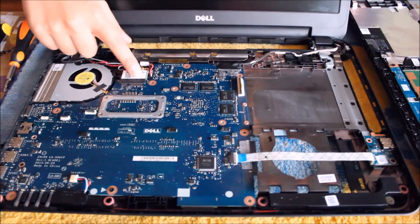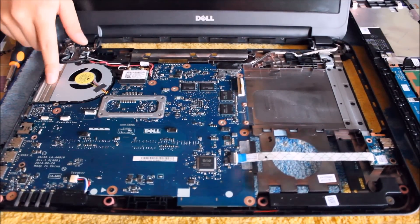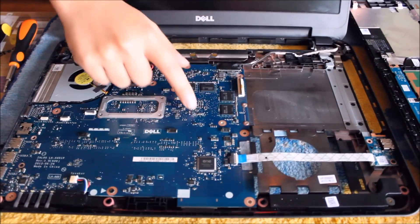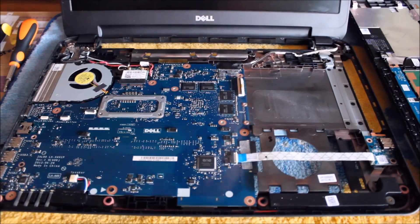The CPU is under there, that's the wireless card, that's the fan, that's speaker 1, speaker 2, and these black dots are your graphics card RAM — your graphics card is behind there. This is relatively pretty easy. There are a number of screws, so remember to put your screws separately so you know where each one goes. Remember the screws have numbers next to them — 2.5 times 3 or 2.5 times 5 — that's all you need to know. And that's it, thanks for watching.